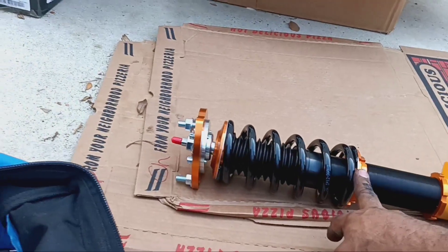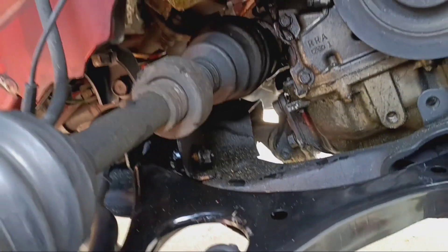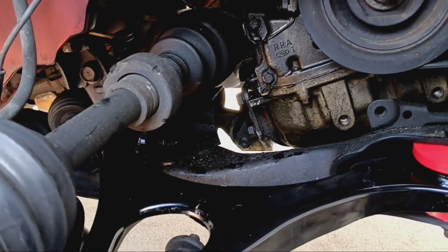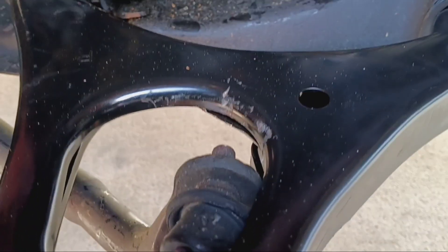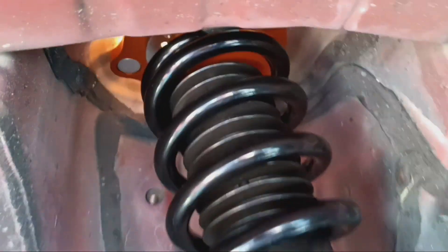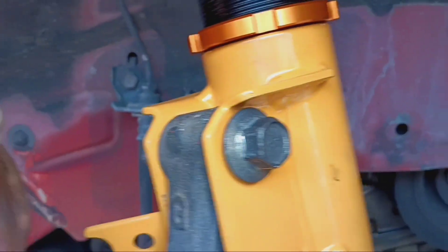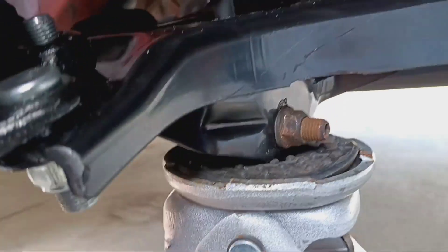Get this adjusted up, get that in, see how it looks. I'm gonna get the nut on there too to hold that, cause I'm trying not to let it pull out of the CV boot — it's all still in there. I also had to undo the brake line from the strut itself, it was bolted on too. Get the sway bar up in there too, you can see the link is there. Let's lift it into place — driveway build.